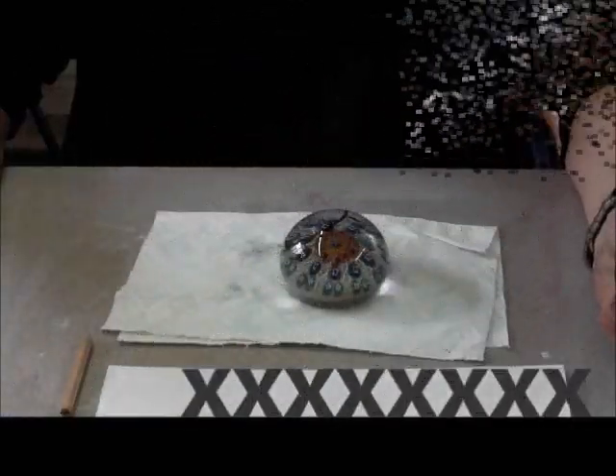We've been doing this half for about 40 minutes now and as you can see it's almost gone but we haven't taken it all the way down. It's just enough to show you the difference between what we haven't done yet and this bit — 40 minutes. I would not normally take a deep scratch like that and use coarse powder. I would normally bring it down first using wet and dry, and that's what we're going to do in a minute.